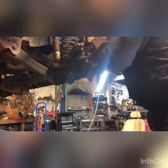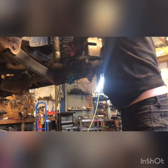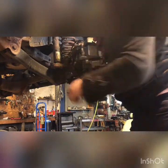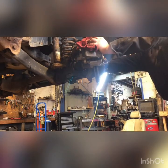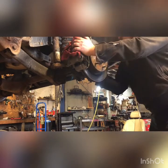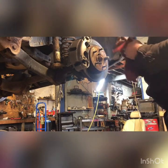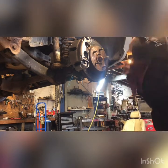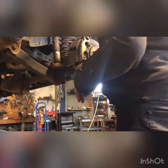Pop my ABS wire back into its home that's all rusted out, about to fall apart. Right. Now pretty soon we're gonna see brake fluid come out of this bleeder. But as far as changing brakes, rotors, and calipers, that's the way you do it. Keep your caliper cores. Usually they need cores. If you bought a reman one, brand new, there shouldn't be a core.